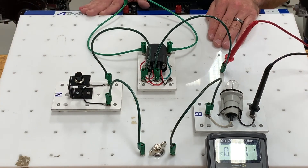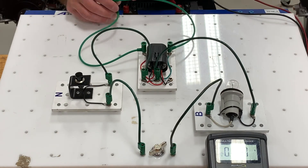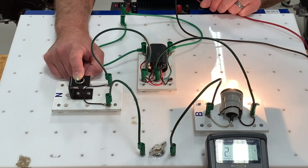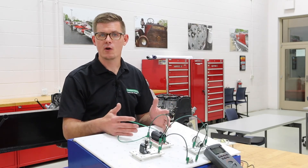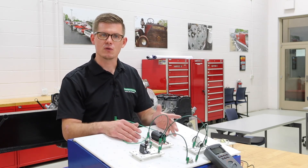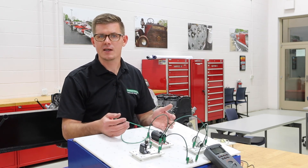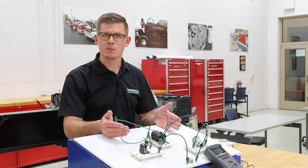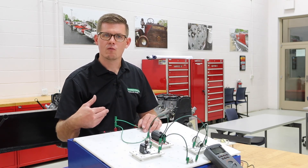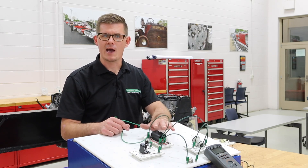At the end of the day, my power supply does have to provide that total, so we can do a quick experiment to verify that. Putting the light bulb back in the circuit and putting my meter up top, we've got about 2.1 amps, which is the sum of my control side and my action side with this larger bulb. That's our video for how a relay functions and how to get one set up, as well as a bit of testing. This type of structure is very common in cars — we see a lot of relays controlling things, and it's going to be useful to have this knowledge as you go through testing and diagnosing different circuits. It's also useful if you decide to add accessories to your car, like fog lights or underglow — it's much safer to use a relay with a switch controlling it, rather than run a lot of cable straight from the battery through the interior. So consider a relay whenever you go to add some kind of high load circuit.